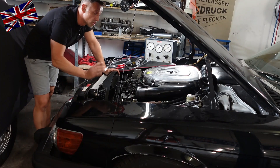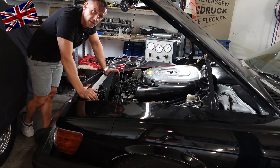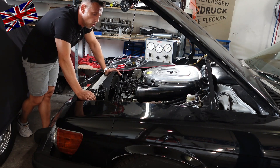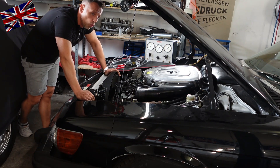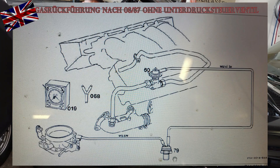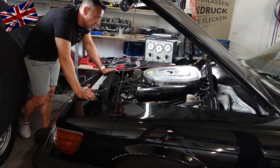They mounted two different systems in 107 and 126 models. They changed the systems in August 87 and deleted the auxiliary vacuum-operated control valve, using an electronically controlled component starting in September 87. From September 87 onwards, without the vacuum-operated control valve. This one here is from after August 87, therefore without the vacuum-operated component. This chart shows the circuit with the vacuum-operated control valve until August 87.